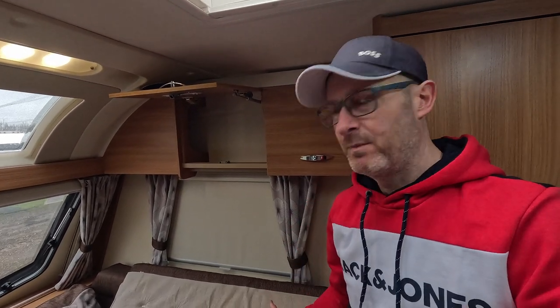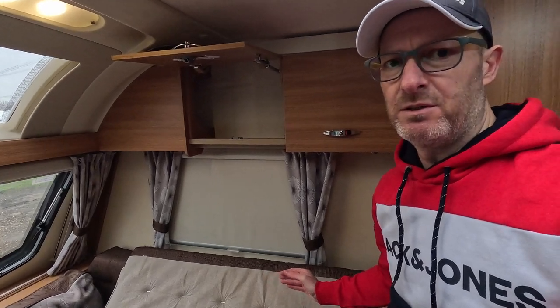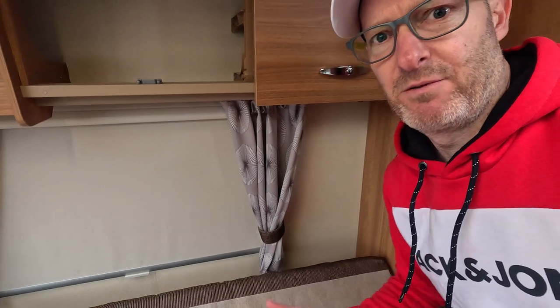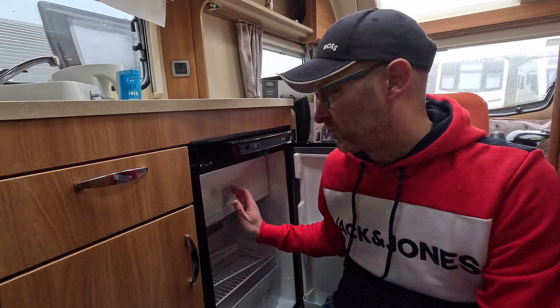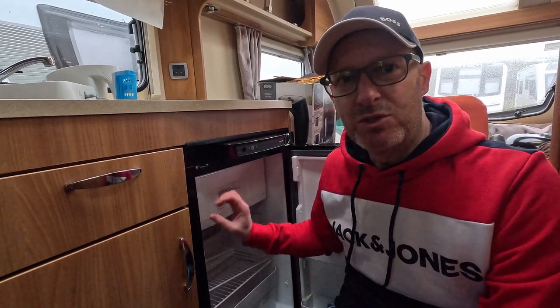The cushions should be moved upright as well. What you're wanting is a gap between the inner skin and the actual cushions, just so there's airflow happening. In this model we've got a gap built in, but it's something to double check. The next space would be the fridge and freezer compartment - I wouldn't leave the door shut on this. When you last use it, make sure it's completely wiped down with no moisture before storage, then keep the doors slightly ajar to allow more airflow and stop the chance of mould building up.